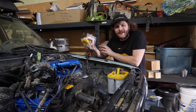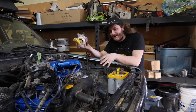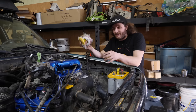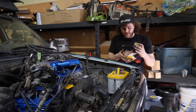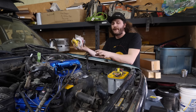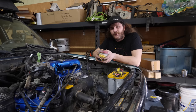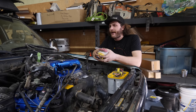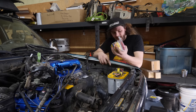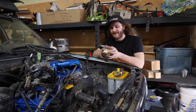We're essentially gonna run this engine in kind of a standalone configuration. We're not gonna tie into the factory fuse box. It's gonna have its own fuses and relays to just be responsible for itself and nothing else. And realistically, the only wire that is a constant wire is the one labeled BAT in those diagrams that goes into the ECM. So that will get its own fuse and it'll go straight to the ECU. That one will be done.